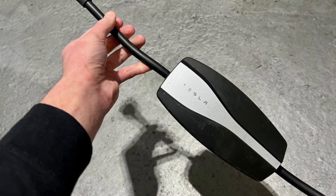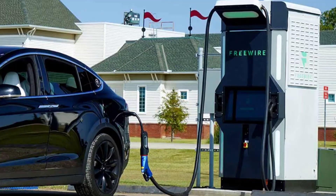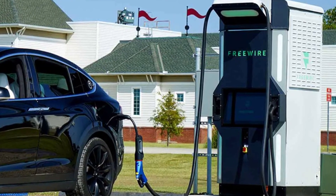If it's AC charging, like a mobile charger for example, you will need to find another mobile charger to check if it works. There is no other way to make sure the port is okay without going to the Tesla dealership and paying the diagnostic fee. So find a friend or neighbor who owns a Tesla and borrow their mobile charger. Alternatively, go to a public charging station with AC chargers and use them to check the AC part of the port.